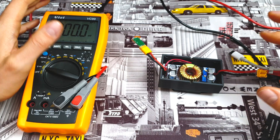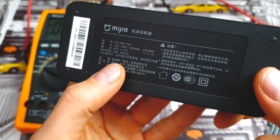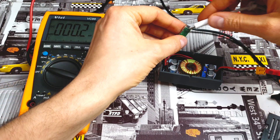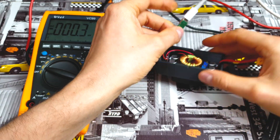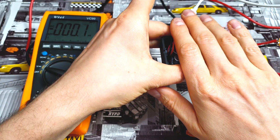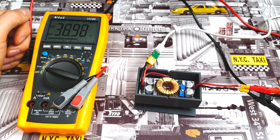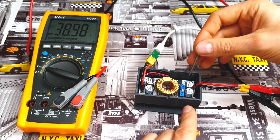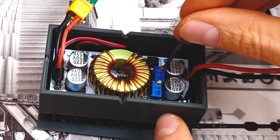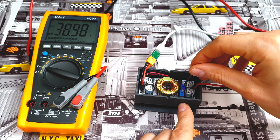Something important for newcomers: you have to set the correct voltage to charge your electric scooter. Usually you can find this voltage on the power supply label — on the Xiaomi M365 you can see 42 volts. So let's connect the magic box to the USB charger. The fan is working and the airflow is quite nice. As you can see, the voltage is currently too low at 38.97 volts — we need 42 volts, so we have to rotate this top knob.